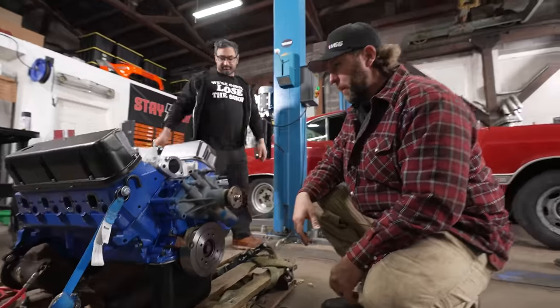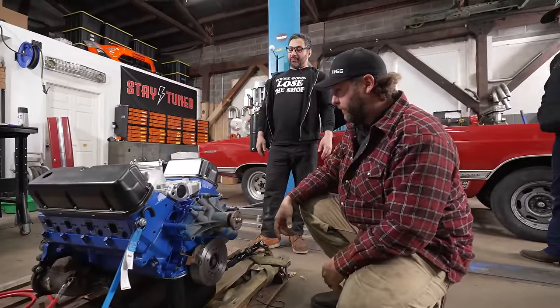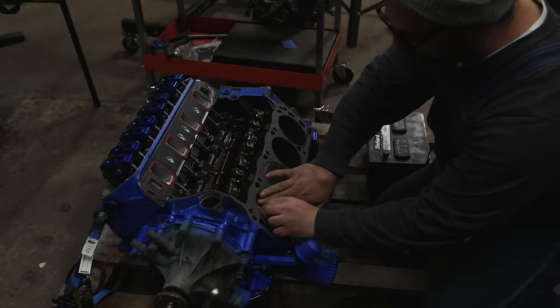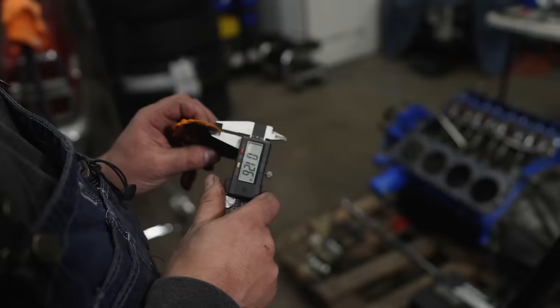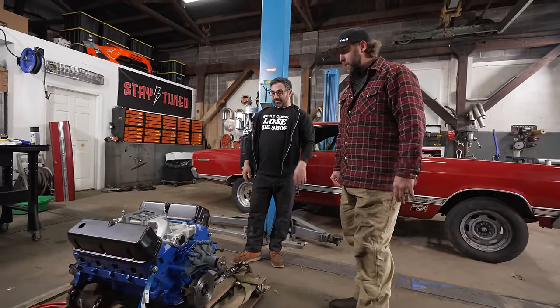Well, I saw the thumbnail you sent me. It obviously runs, right? There was fire shooting and stuff. It does. I dialed it in. We went back in. A couple people were like, that's a lot of lift for that motor. So the other night I came in, I put clay in it, ran it through, and double-checked everything. I put the right hardened push rods in it, so we should be in business. The valves aren't shaking hands with the piston? No, they're close, but they're all right. So I went back through.